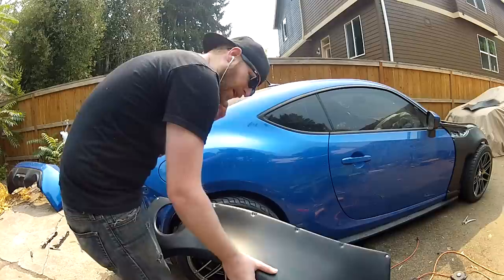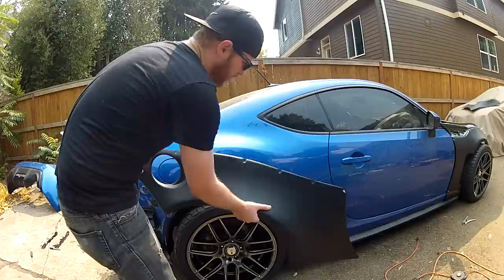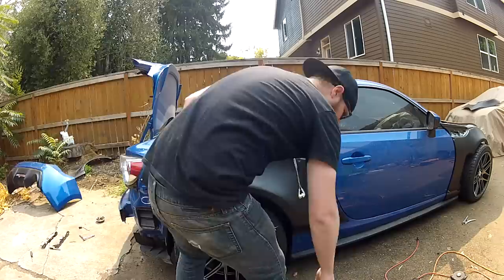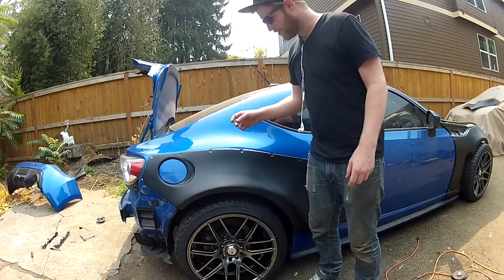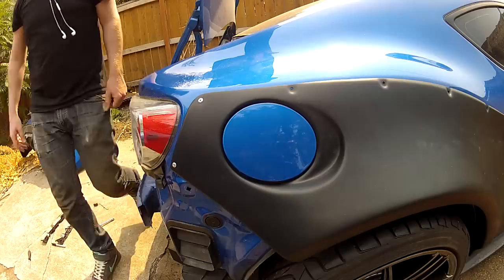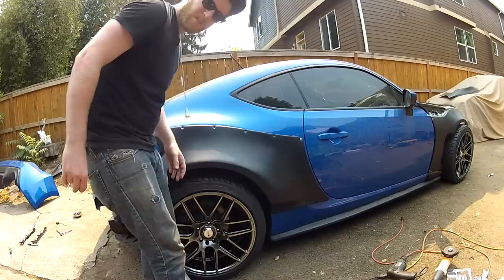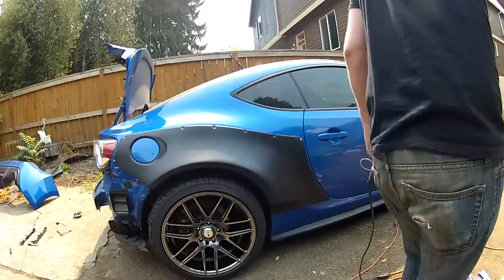This is fitting up pretty good. This panel hasn't been wrapped yet. I'm going to set a couple of rivets so I can make sure the next holes in the car are in exactly the right spot — I'll set these three rivets here, here, and here, then drill them out later when I'm done. This piece is a little extra technical because of the gas cap, so let me double check that the gas cap opens. Feeling really good about where this is, so I'm going to shove the drill through the holes and mark out the rest of the rivet holes.